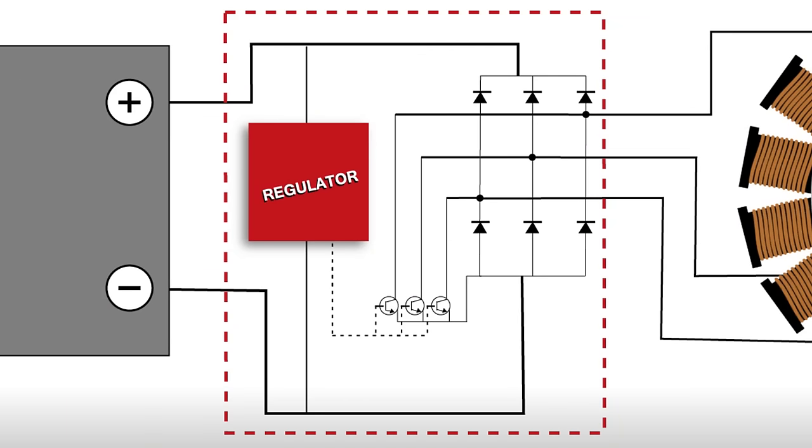The trick is, there's other circuitry that you can't measure from outside. Let's refer to the next drawing. All right, as before, those are our six diodes that we're trying to test. There's your regulator rectifier, and you've got these three, looks like SCR type diodes there. What would they be doing? Well, a regulator limits how much current or voltage is coming out by actually shunting out each one of these legs to ground.